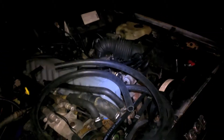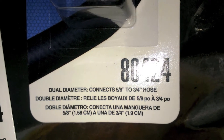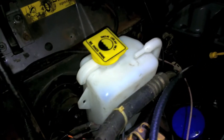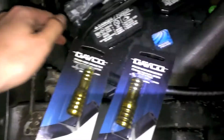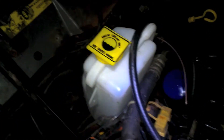Okay I'm finally back and as you'll notice it's a little darker out. These were such a pain to find, but they are adapters — they go from 5/8 to 3/4, heater hose adapters. I found out this is where I'm gonna put the coolant bottle, with the hump sticking towards the back — that seems like it fits a lot better. When it rests it'll rest down on this hose. So we got the spout here, here's the 5/16 fuel line — I'm going to cut that to length and hook it in there, run it across all this, zip tie it up here so it doesn't hit the fan, and into the radiator. These hoses I'm going to cut up and hook up to the heater core and attach with those adapters. Then we'll have to figure out some kind of bracket to keep this thing in place.